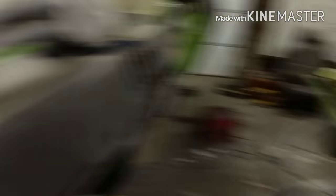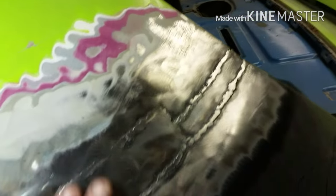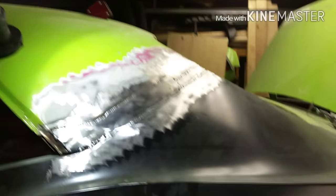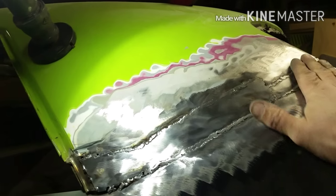Living in a cloud of dust here. Battery's going dead — it's Saturday evening, better get at her. Okay, the grinder's making me look pretty good. I'm happy so far, no major warpage. I've got a couple more spots down here to fill, a couple little pinholes, but other than that it's never gonna flex, never gonna crack. I'm going to do the same thing on the other side — that'll only need about a one-inch patch. It's got a little divot for some rock-solid filler. Didn't get back to the door yet — that's all, see ya.